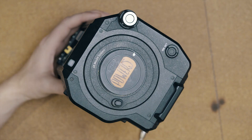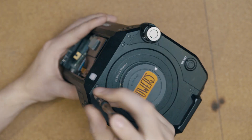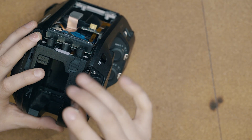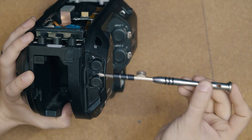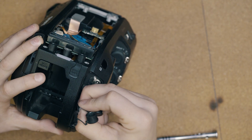Facing the front of the camera, remove the top left screw — it's the only screw on the front of the camera we'll be removing. The next screws include one holding down the protective cover, two next to the SDI outputs, two next to the HDMI port under the protective cover, and two larger Phillips head screws near the XLR inputs. Here's a fun tip: put a magnet on the side of your screwdriver so you don't lose any screws. Then gently peel back that cover.